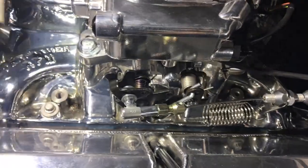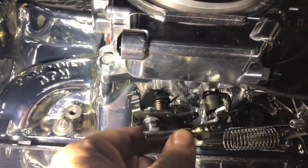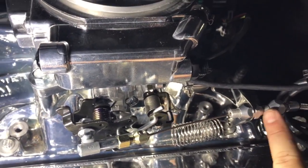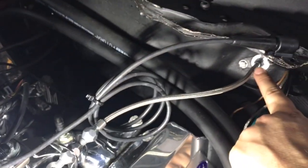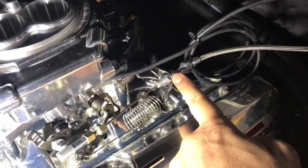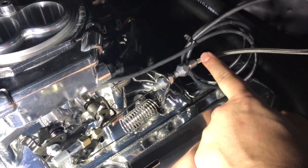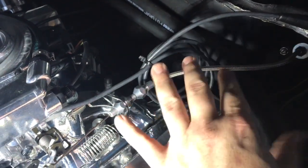The way it works — the first trimming you do is from the point where it mounts from the firewall to the bracket. That's the first piece you cut, and you make sure you cut it with the cable out of it. You cut that here and you give yourself a little slack just in case the engine wants to move back and forth.